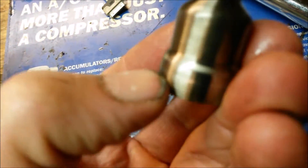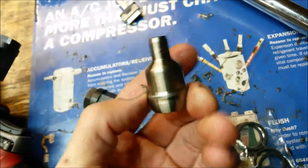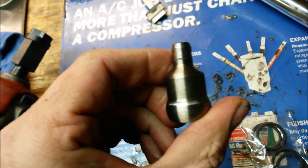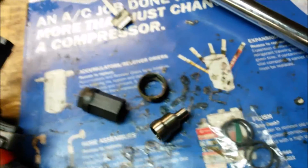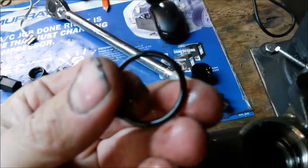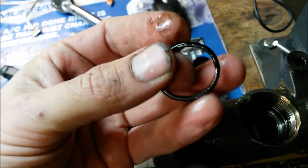So you want to make sure you take a good look at the ball there. If you've got any wear at all at the top of your ball, you'll want to look at getting a new nipple cup — we're going to have a bulletproof one come out pretty quick. Take out the O-ring. Sometimes they're obviously bad, sometimes they just look a little hard and deformed.